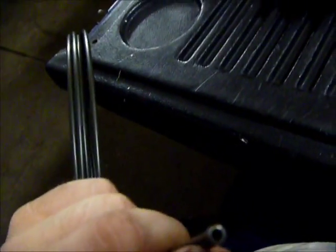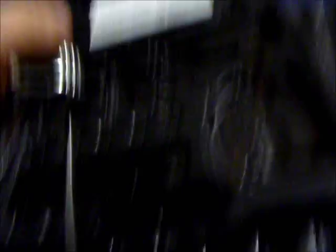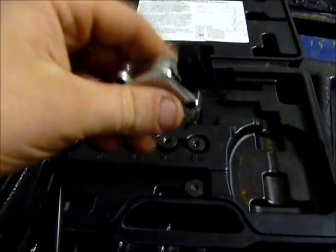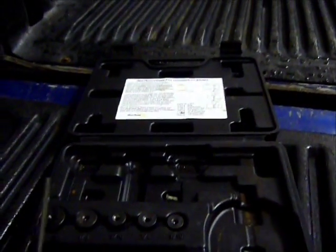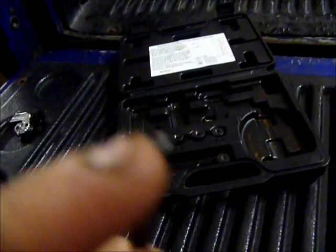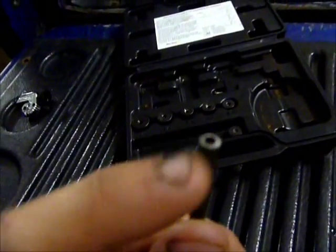The first thing you're going to need to do to flare this 3/16 inch brake line is to cut it with a tubular cutter so you get a nice round lip like this one — I've already done that. This is a tubular cutter. All you have to do is install it on your brake line, and while turning it, tighten this knob tighter and tighter every couple turns until it finally breaks off. You'll also need to ream the actual brake line because sometimes you'll get a lip on it. You can use a screwdriver, a knife, or some kits actually come with a reamer. Just be careful not to damage the line.